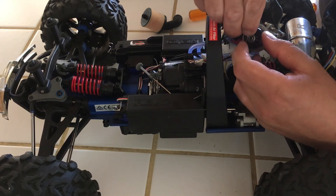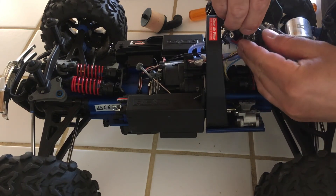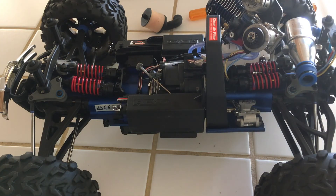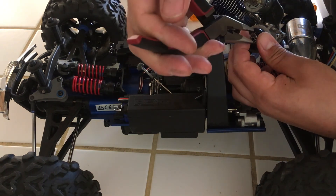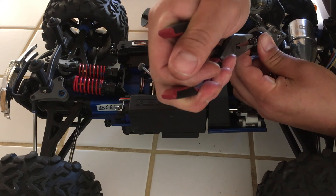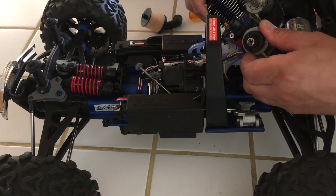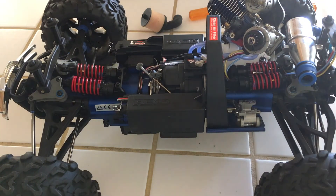Make sure that the bearings are where they're supposed to be. You're going to notice a little groove on the shaft of the engine — that's where the E-clip goes. Just place it there. You can use gravity. Grab some needle nose pliers — just anything that will help you put your fingers on the sides of the bearing so that the E-clip doesn't try to slide or turn. Just clip it on, and that is it. Now the bell moves freely as it should, because it's only until the clutch engages. That one's good.